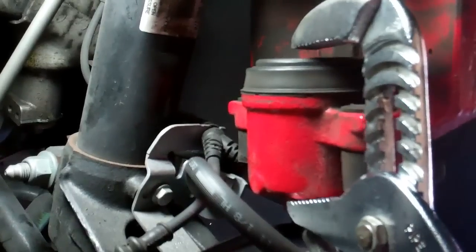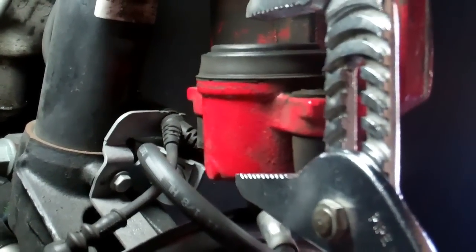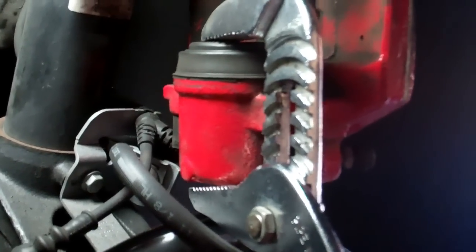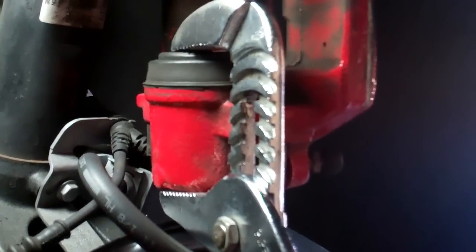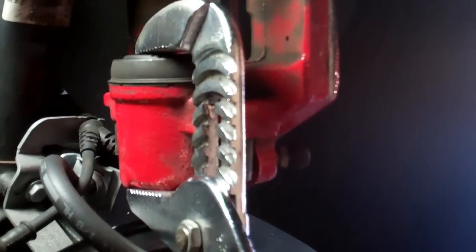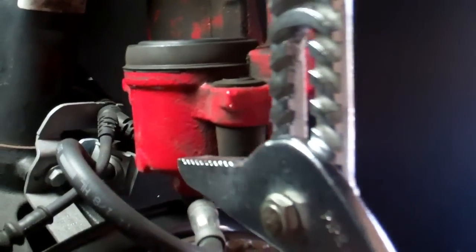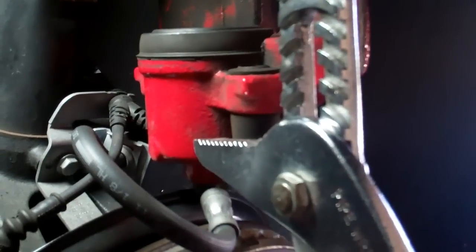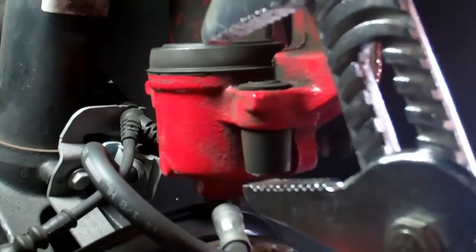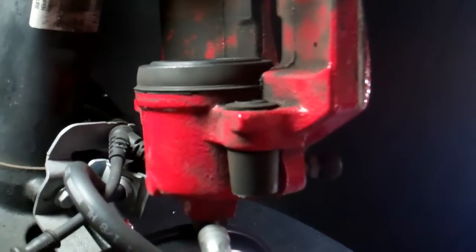So when you're almost ready, you want to press your piston back in just a little bit. As your pads wear down, your piston's pushing out and your brake reservoir fluid level's going down. So I'm just going to push it in just a little bit — be real gentle, you've got seals here, don't force anything. A channel lock is working to get it down. I don't need much because my pads aren't too worn, but be careful — you do have rubber seals there. Also note, as you're pushing these down in all four corners, your fluid is going up in the brake reservoir. If you have ever topped it up, you could have a problem and it could overflow. I've never topped this up, so hopefully this brings me back to stock level as all the pistons go back in.